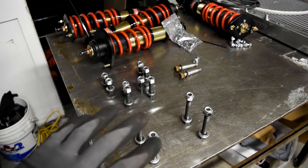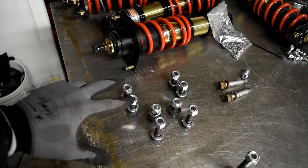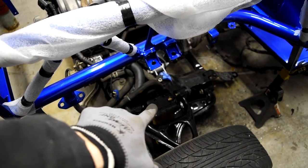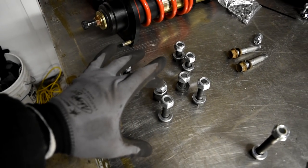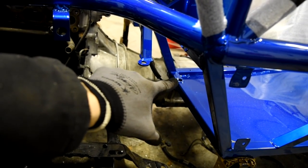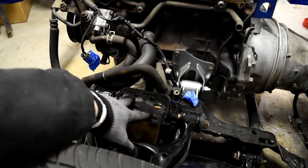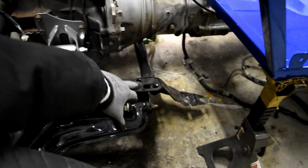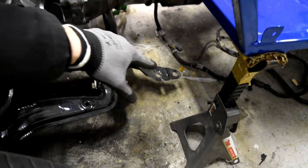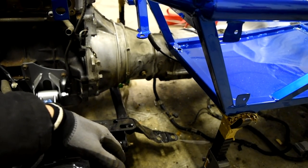Here we have 12 bolts that are laid out in roughly the same configuration as to where they mount to the actual chassis. This is the back, here's the front. There's two bolts on either side which actually mount directly to these fingers right there down into those holes where you can see the two by four. Then you've got two right here that actually mount through two small plates — one right here, and another one goes through the actual square bar down into the back part of the front chassis or the front subframe. There's four bolts in the chassis — one here, one here, there's another one that goes down there, and the last one is the second to last one right there. It'll take you about five minutes to bolt them in and torque them down.